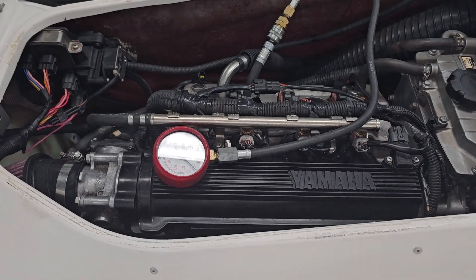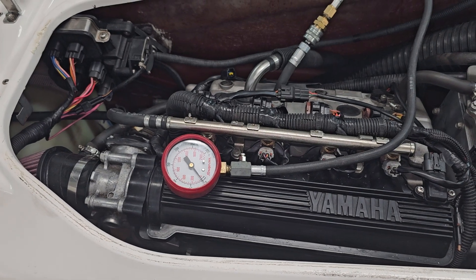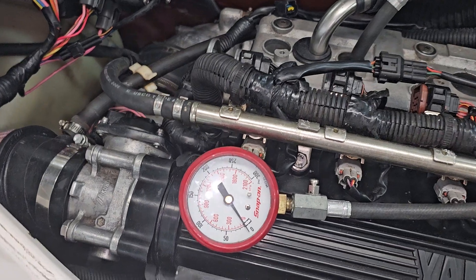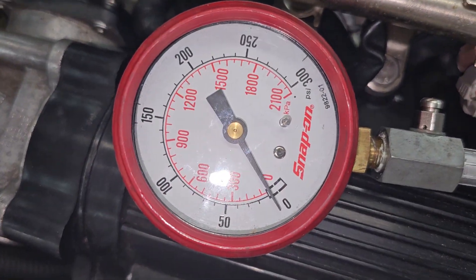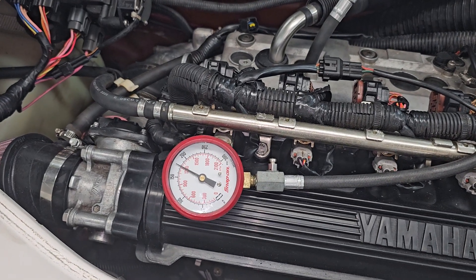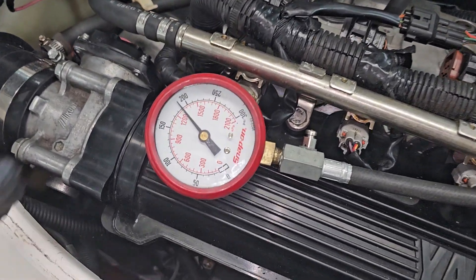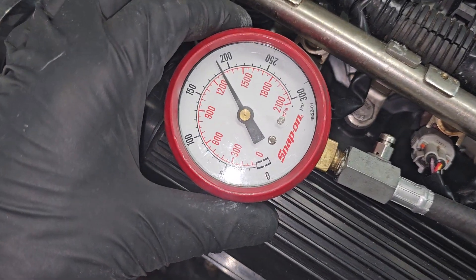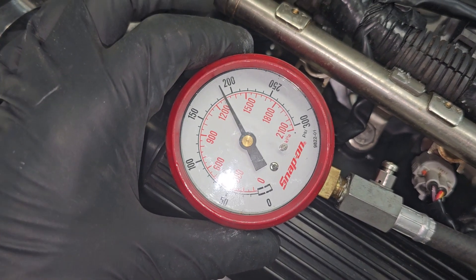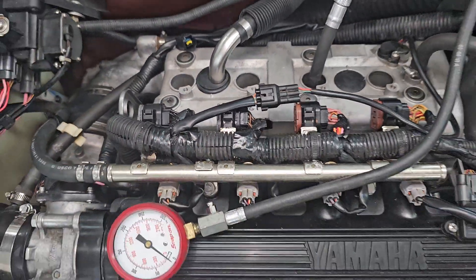This one on the plug read we said should be the second best. Looks like we're about 9 PSI short on this gauge. You can tell it's better, but not good. We're right at 189, so I'm going to call that 180. I should have been writing these down from the get-go — I forgot what the first one was already; I know it was in the one-teens.